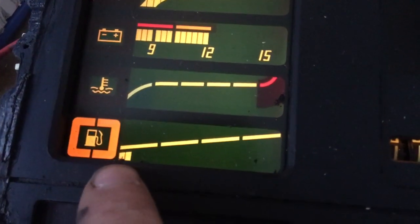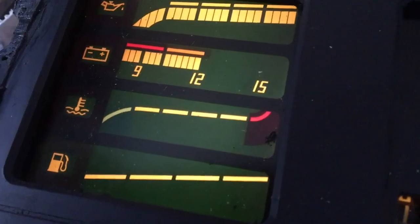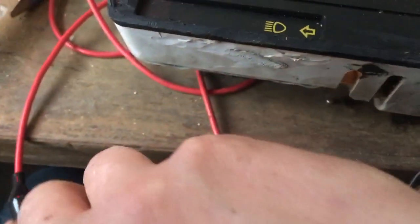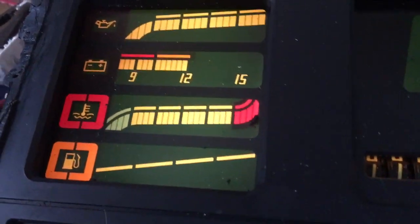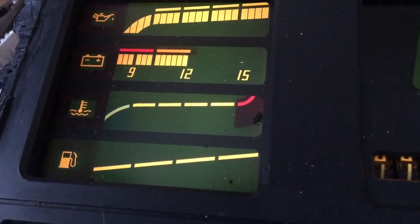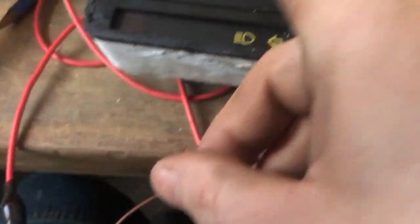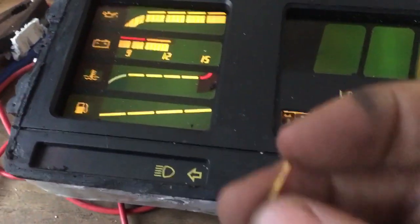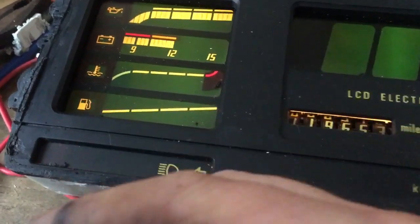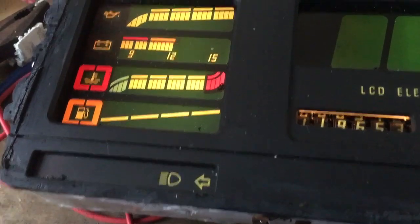It's dropped down to the last bar and it's flashing to refuel — great. Next on the list is all blue which is water temperature. I'm going to touch this to negative — full negative and it's warning us that we're overheating. Let go and everything's okay again. This works in resistance: as you put a water temperature sensor in between, the resistance varies the temperature reading. It's checking how close we are to ground — if we're fully earthed it's going to warn us we're overheating.